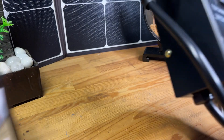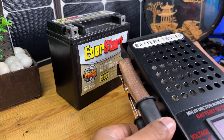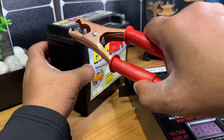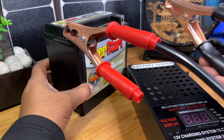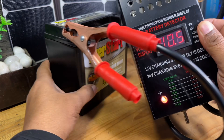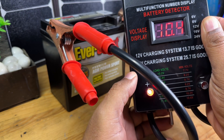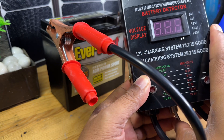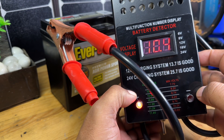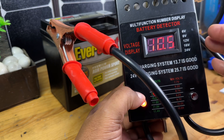I have a motorcycle battery here. Let's see if we can get a reading off of this battery. We have our positive and we have our negative connectors. Let's clip onto this battery. You should be able to see there's an indicator right there. So we're gonna just cycle it. That's coming through as 10.5, 10.4. That means this battery is underpowered because it needs to be around 12 volts in order to be able to start a motorcycle. So that's gonna give you a quick indicator of the type of load this battery can take.